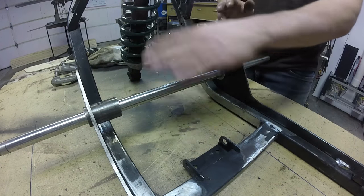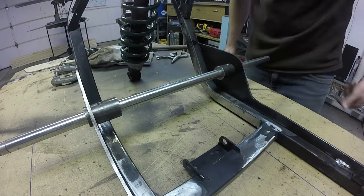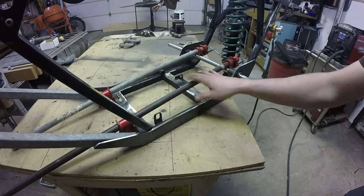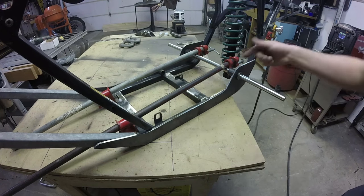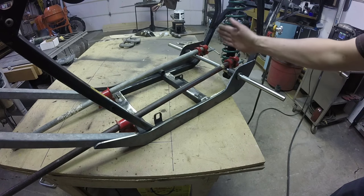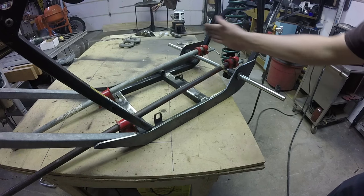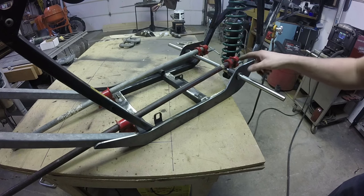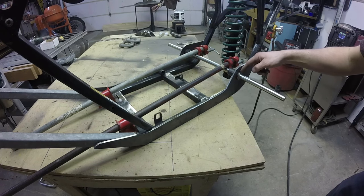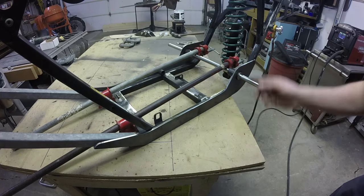And that's going to be what I can square up my rear swing arm to. I just threw a couple of pipe clamps on here, just pulling on this temporary shaft that I put in. That's putting a little bit of tension on these bushings and making sure everything stays square while I weld it - basically clamping these in place. I've stuck these out on either side a quarter inch, just giving me something to weld on. So I'll go ahead and weld around each side.